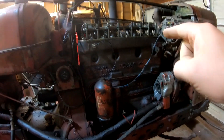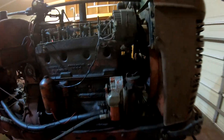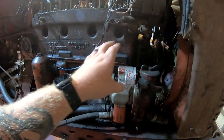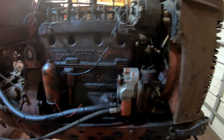Regardless, we're going to have to pull the head, which means draining the coolant and oil because we need to take the pistons out to look at the rings. If we want to take the timing cover off, we can pull the pump off, but we also have to look at the cam gear and the crank gear to make sure everything is kosher there.